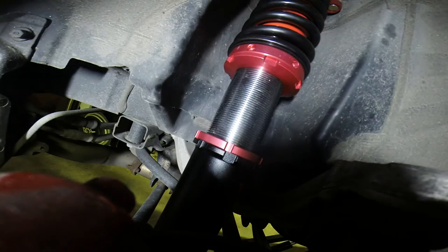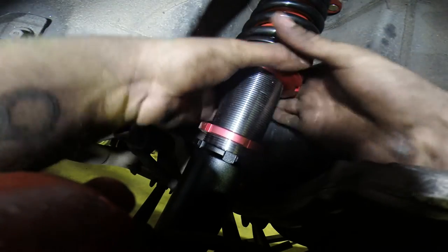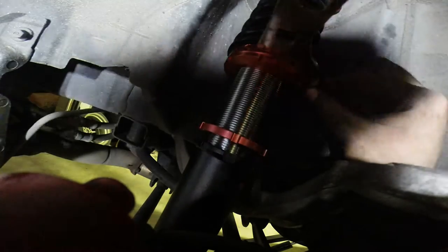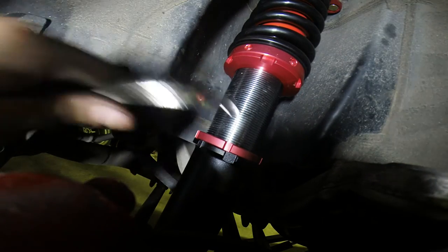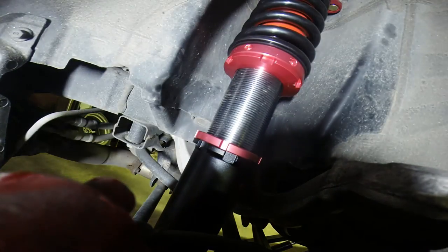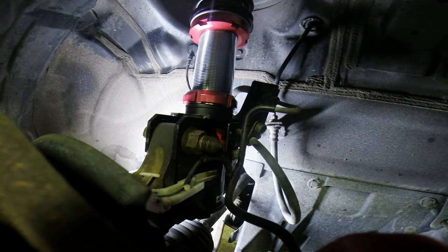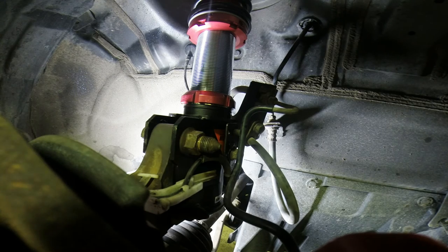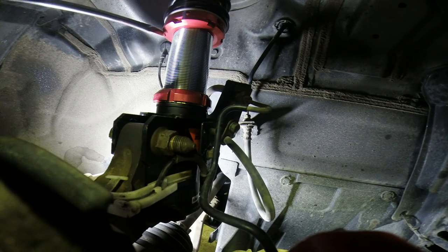Now that's nice and snug. When that's on the car I already showed you in the front — same thing in the rear — you can grab the whole thing and walk the whole assembly down, or by using the big spanner wrench you can click it in a hole and adjust the whole thing. Going into the bottom one, we're going to see how far we have to go. Right now just going to hand tighten everything, put the wheels on, drop it down, see where it's at. Now we're just buttoning up, tighten everything up nice and tight before we take it for a road test. Put a screwdriver in the right direction to tighten it, take a hammer, give it a couple taps — same thing with this.